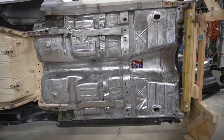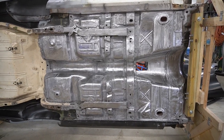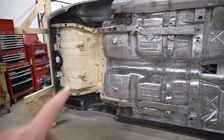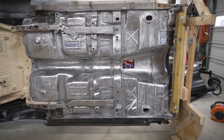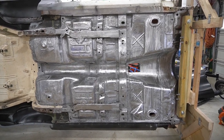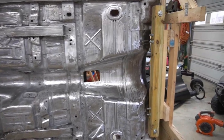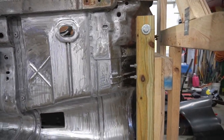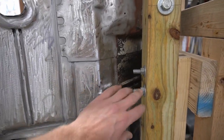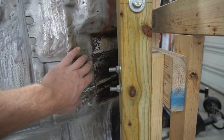All right guys, quick check in. So we got the main part of the car done, and I'm going to go ahead and prime this today because it'll be a little while before I get to the rest of it — I'll explain why in a minute. This part is ready to go, ready for primer. I've cleaned it about four times so far and we'll do it once more before we prime. We're going to prime up to here for now because when we do the firewall and everything, we'll probably bring the paint down to about this line here, so let's give us a little bit of overlap.